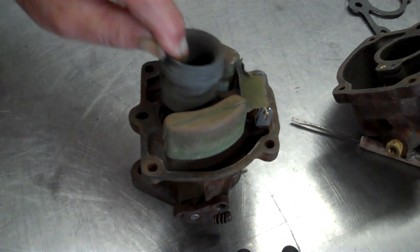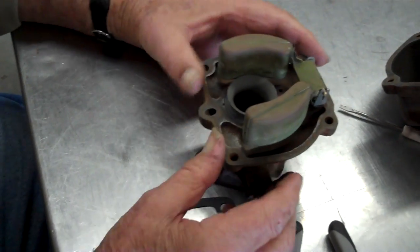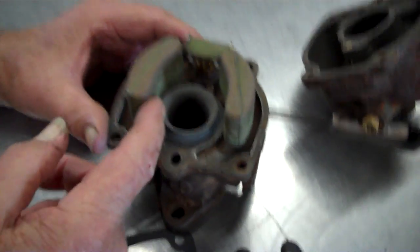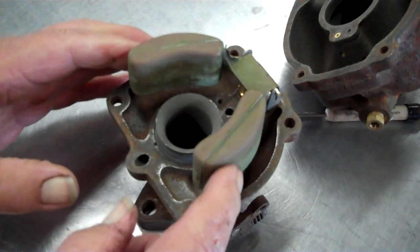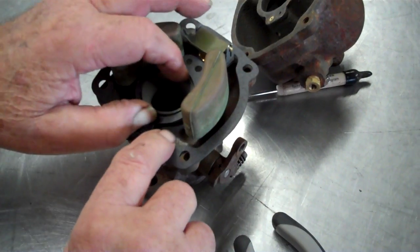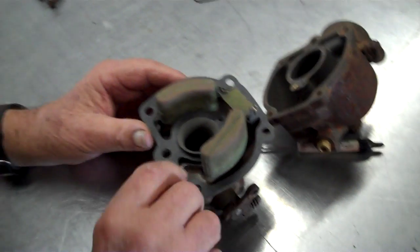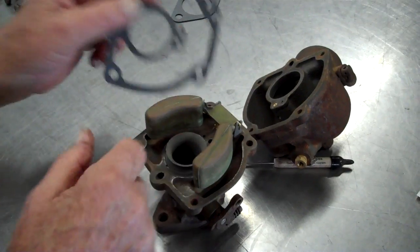The big part is bigger than that — it goes in there like that, and this gasket goes right there. See how far that float is from the center — they need to be. I have gone too far and this float will hit the sides of the carburetor bowl and it won't work up and down. And this gasket goes right there. We need to turn it over because them holes don't line up the best.